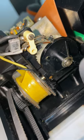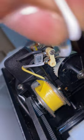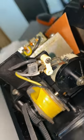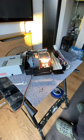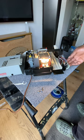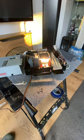Simple fix — all I've got to do is get this toothpick in and bend it back slightly. You can see there — that's all it is. Then turn it on and, as you can see, I'm now able to operate it by the switch and it doesn't run forward by itself.